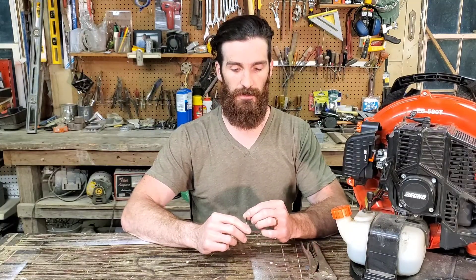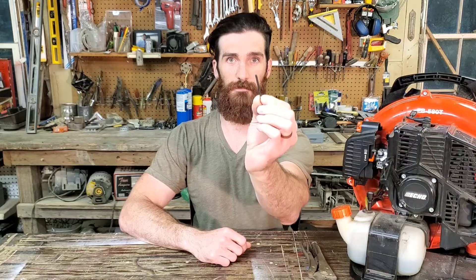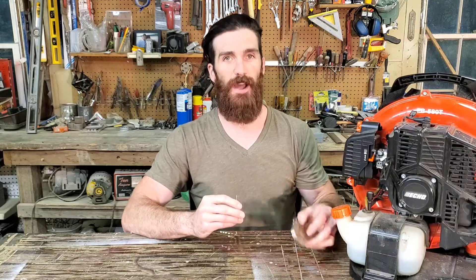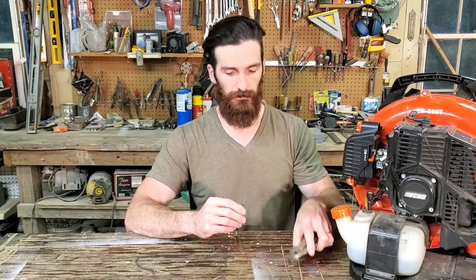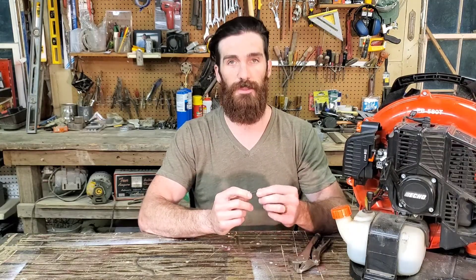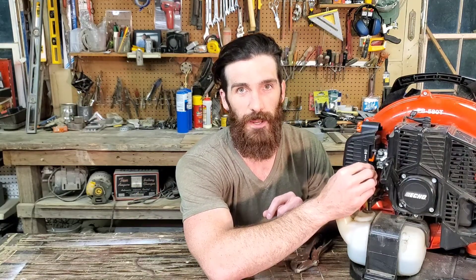What I found instead is a roll pin, also called a compression pin. You can get these at any hardware store — Ace Hardware, Lowe's, anywhere like that. This is a 1/8 inch by 2 inch roll pin. You'll want to use a vise or vise grips to flatten the shape on it to get it into the shape of that D so it can go in there and adjust the screw. I noticed the diameter of the pin was too big, so I had to get it down to a smaller diameter to actually fit in the hole for the high-speed screw adjustment.